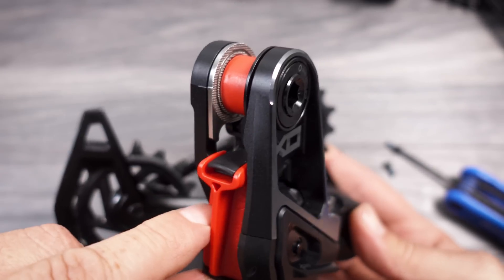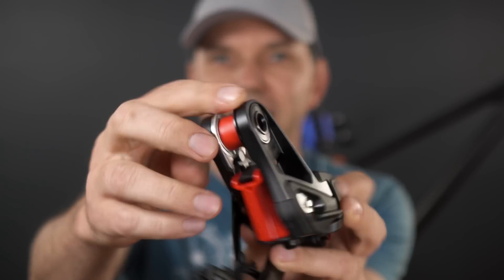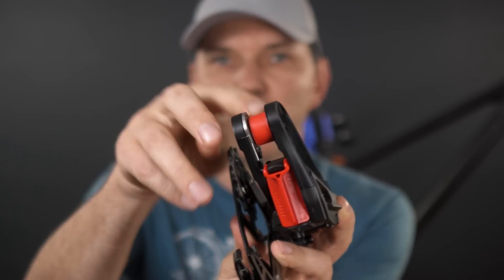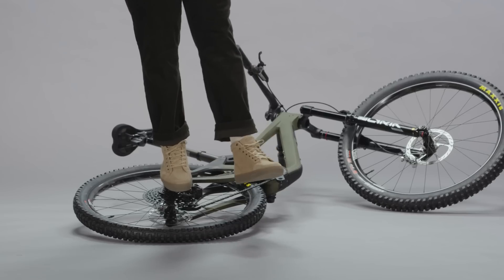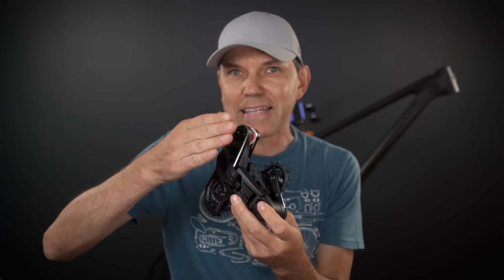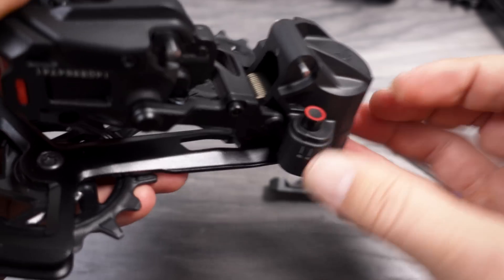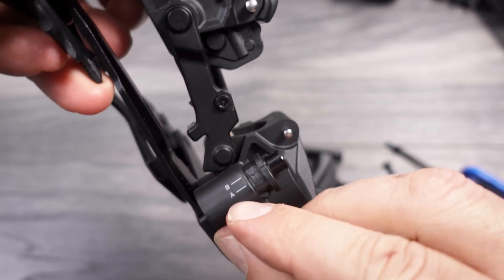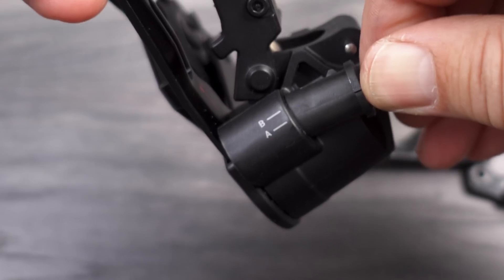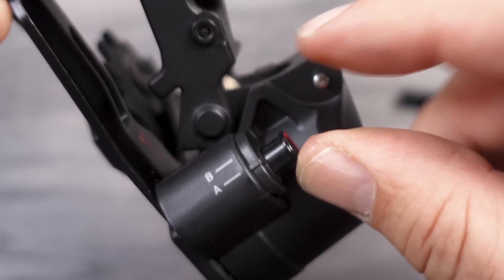Obviously there's the attachment of the battery. Those two brackets of the full mount pretty much hugging your frame and sitting sandwiched on the thru axle can withstand over a thousand pounds of force — and that's why during the launch we saw all kinds of crazy videos with people jumping on it, specifically right here on the brackets. Further down you're going to see this big knuckle that is housing your clutch. This is the A/B setup key and cage lock that has to be chosen during installation. By default it comes in the B position for full suspension; A is for hardtails. You just lift it up and push it into place, and you have those little tiny lines that will line up with A or B.